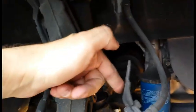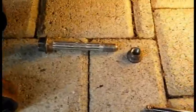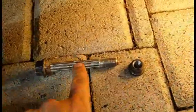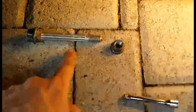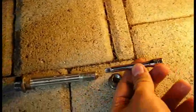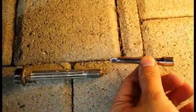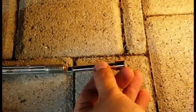I've already released the brake line bracket so that doesn't get in the way. I got the bolt out — you can see it's pretty long, about 6 inches. What I ended up doing is using a socket extension and a hammer. Once I hammered it through a little bit, I used the socket extension and hammered it through the rest of the way, through the lower control arm and the rest of the fork.